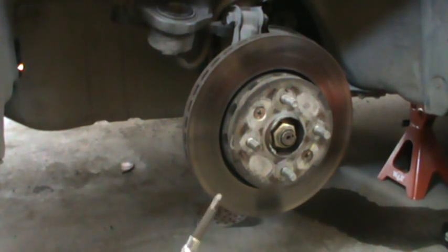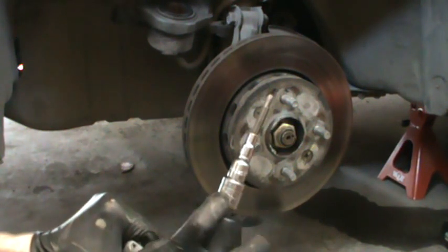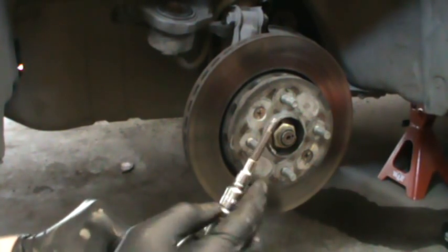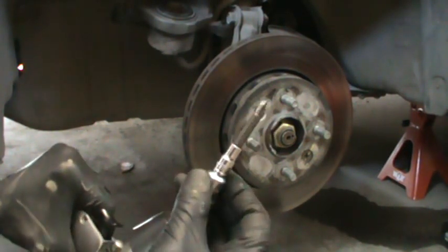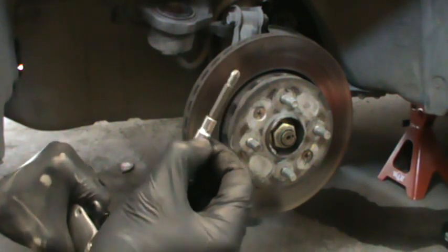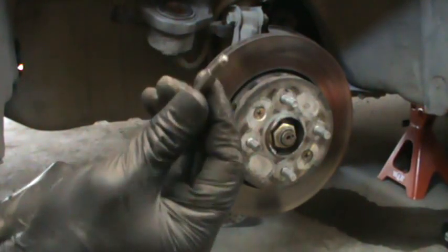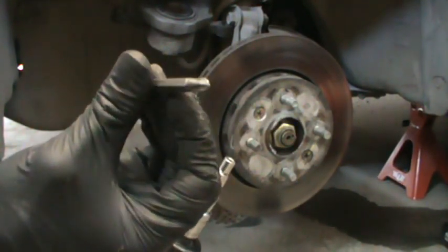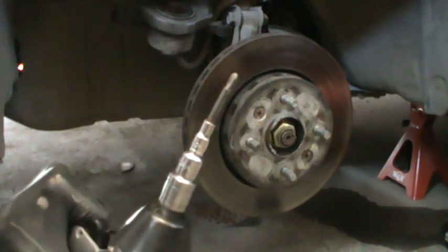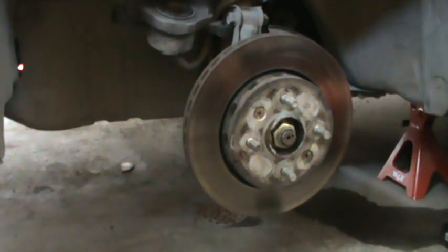In order to get this off with an impact wrench, I have a reducer to a reducer to — I believe — a quarter inch socket to a blunt head Phillips. I'll hook that up to the air and just impact that off.